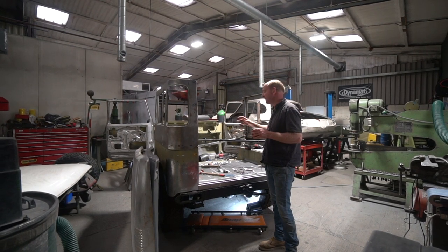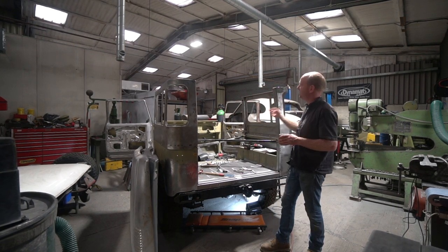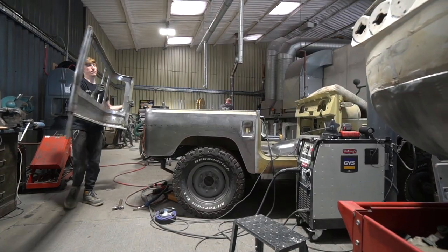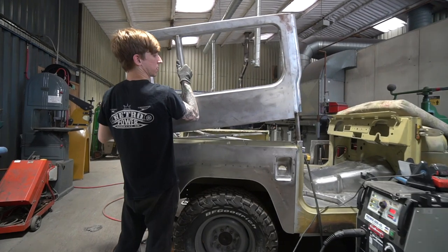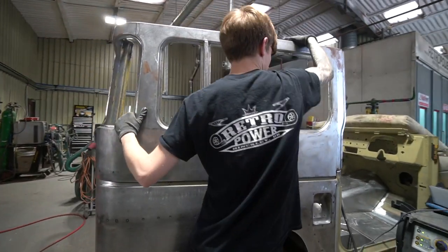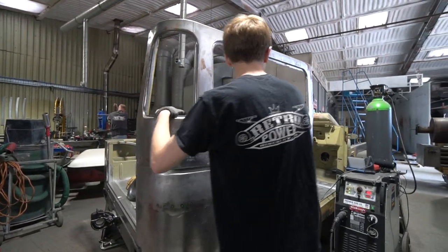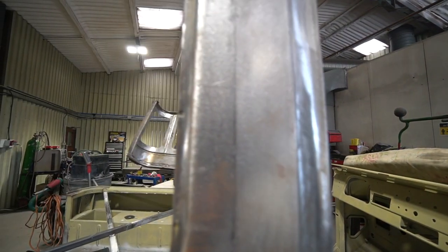And to that extent, in terms of making sure things still fit the car, as you'll have noticed here, Tom's now started refitting all the panels, drilling holes for mounts in new sections that are welded in, basically getting it all completely panelled up so that we make sure everything fits before he does the final bits of welding on things that could alter alignments, and also making sure that everything still fits the chassis and all the mounts still fit, that everything goes where it should be.